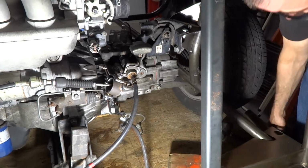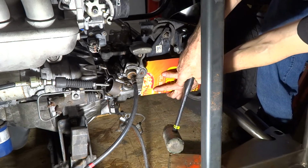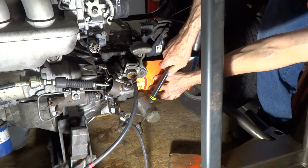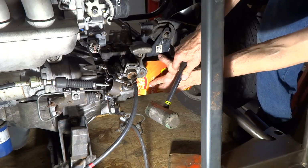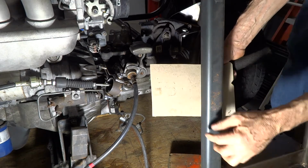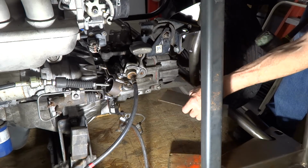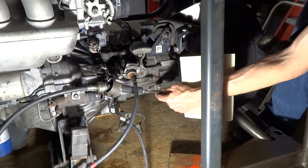So what I'm going to do first is pick up my 3 holes like this. Just lay this up against here. Use a plastic hammer. Hold it real steady, hit it on all 3 of these, which I've already done, but hit it where all 3 holes are at, and that will give me my pattern of my bolt holes. So I can start that bracket, and then it'll be a simple matter of an angle bracket out to reach this.